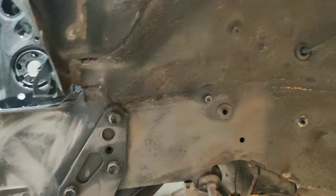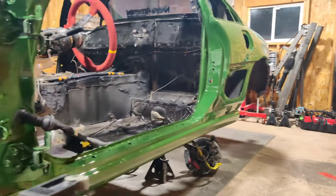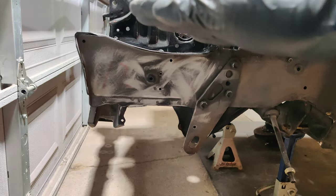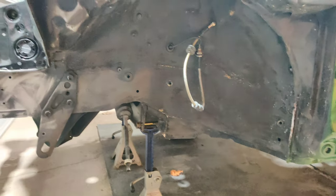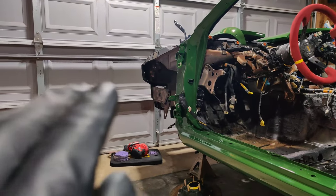I sanded down the majority of everything that needed to be sanded. I did sand the lower half a bit more than the upper half — this is going to be closer to the ground. I don't plan on driving this car during any type of winter, but let's make it common sense — water will get everywhere in the wheel well. The majority of what I want to protect is the chassis, so the level of thickness will be different from top to bottom. That's just something the way I like to do it — that is not what it says in the manufacturer instructions. Let's jump on to the back wheel well.